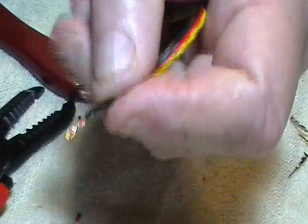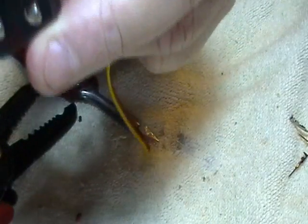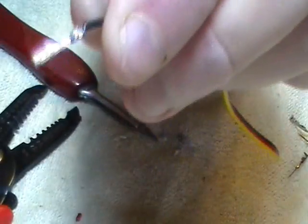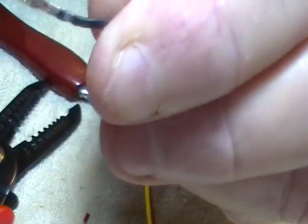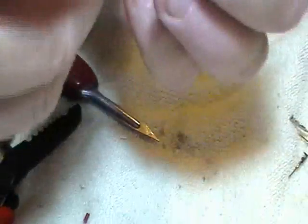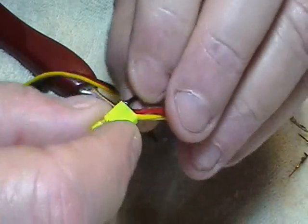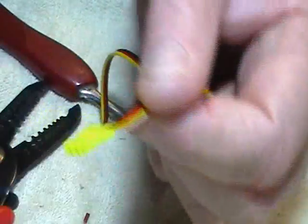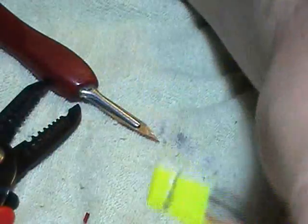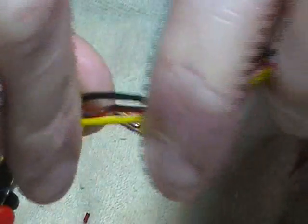On the last one, fold the little wings in just to hold it while crimping — this one rolled in perfectly. Squish the wide part back toward the center to round it up, then push it into the housing. It went all the way in too. If you don't round that end, they won't go in very well. There's your female end, all done. To remove a pin you'd need to take a tiny screwdriver and pry those little tabs up.